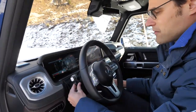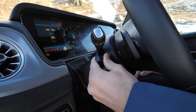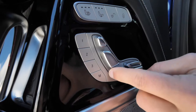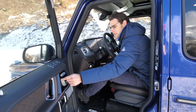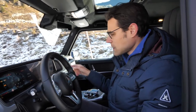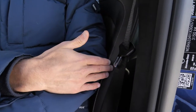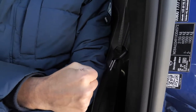You can also lengthen the lower seating area, the front and back sections, and even the head restraint with electric function. Heated and cooled seats are also available, and a seat massage function too. Interestingly, those side bolsters always pump up in the corner at the opposite side when you go in a corner — so when you turn right, the left bolster pumps up a little bit and goes stiffer, holding you tight.